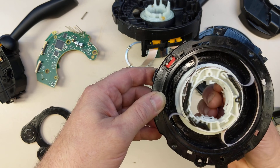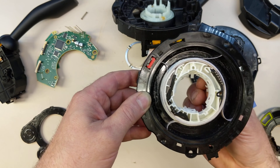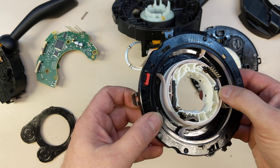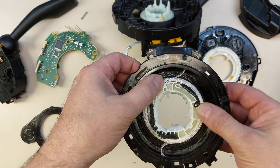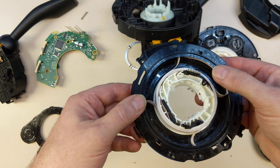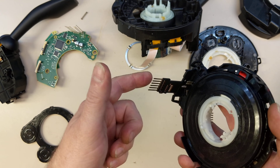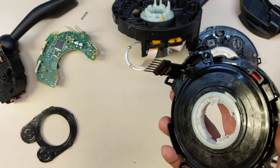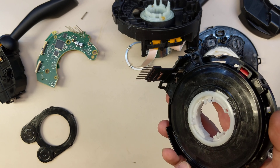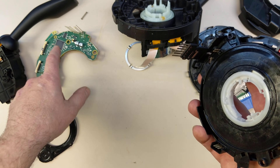That's about the end of it and it goes back the other way, and stops there. These ribbons are high-flex Kapton-style ribbons with conductors in them, and they're terminating into pins that engage the connectors in the wheel. On the back, these connectors — those are for the airbag, which leave directly. And then these connectors carry the steering wheel control information, which goes to the NEC processor.